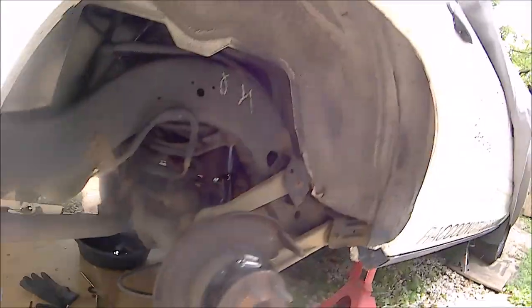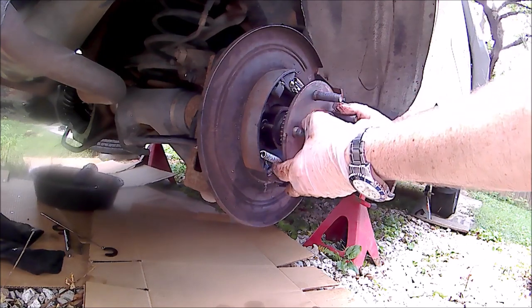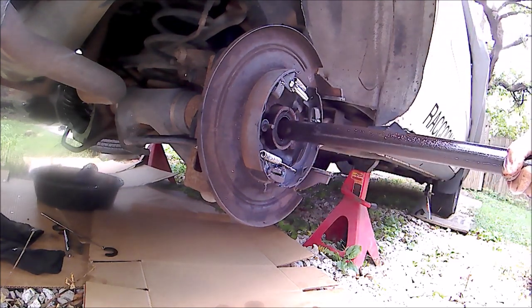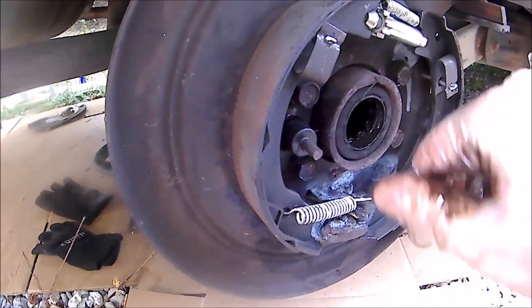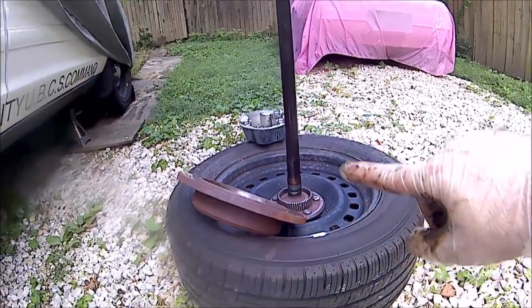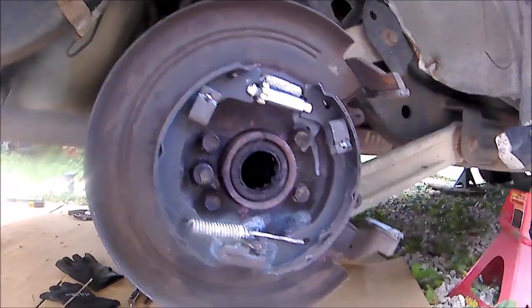Well, I pulled a skull here on the driver's side — I actually broke the ABS sensor. So now we have no ABS on that side. It's not like the BMW where it's a very short sensor that plugs up close; this one seems to run all the way up into the car's interior. Got the axle out. If you don't want to break your ABS sensor like I did, try to pry it from the back side of a screwdriver and bang it out carefully. That's the whole axle — we'll clean up around the edges, then pry out the seal and slide hammer out the bearing.